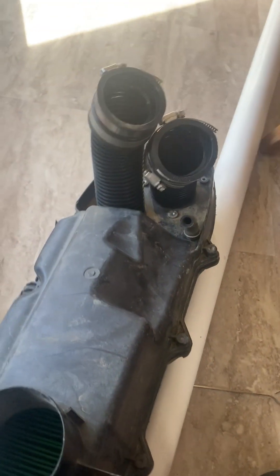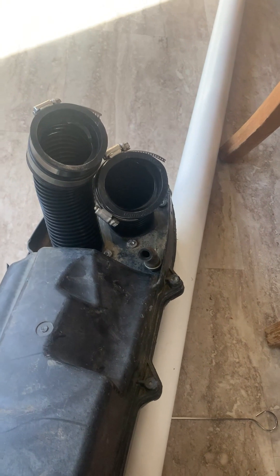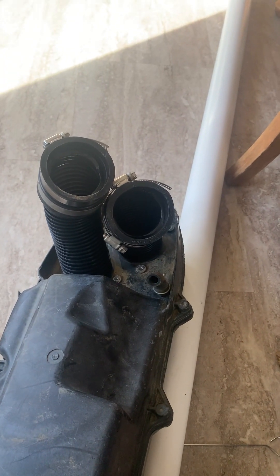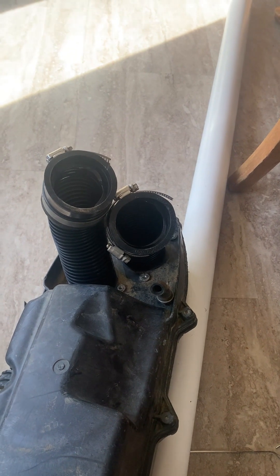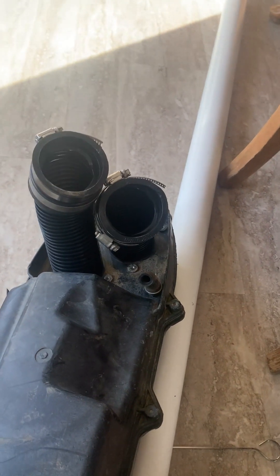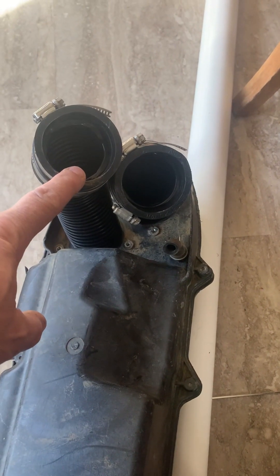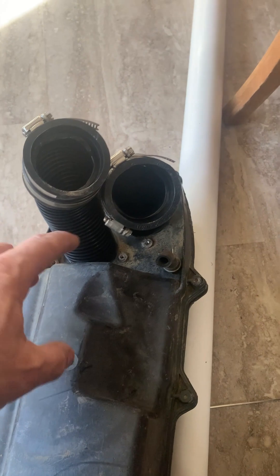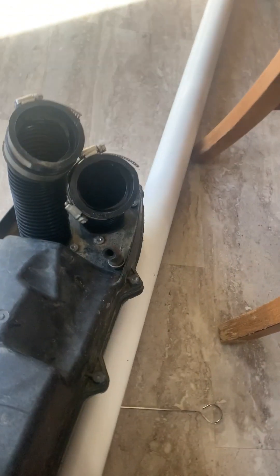The two-and-a-half inch shop vac hose fit because there was like an eight-week delay to get the factory hoses, and factory hoses were going to be around 100 bucks through Partzilla — about 40 or 50 dollars a piece, which kind of sucked. But I took a two-inch rubber union, ended up cutting it in half, using one for each side. They fit perfectly, and that's what got my brain working.